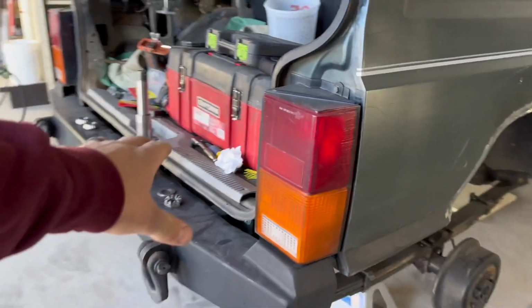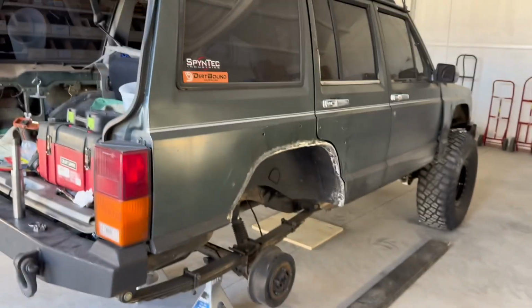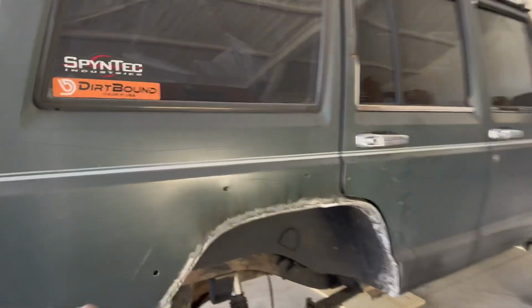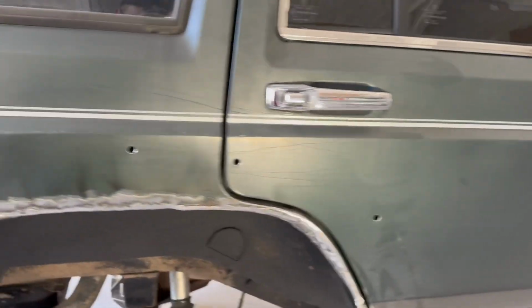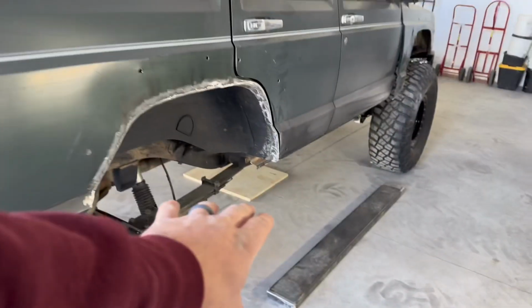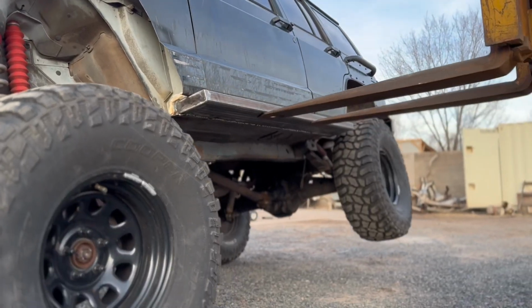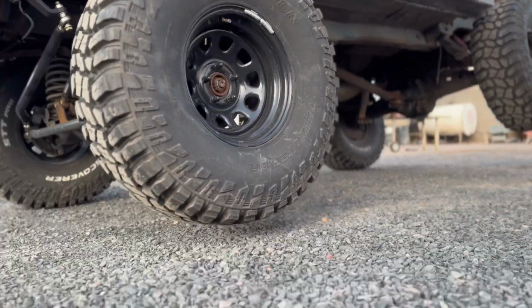He's got the bumper bolted back on because he's got the notch flares mostly mocked up now. They're back off for now. He had to drill holes all up in here, weld this seam all back together. Working on the 2x6 sliders. If you guys haven't seen that video on my buddy Corey's Jeep, I will leave a link in the description on how to make your own sliders.